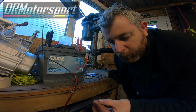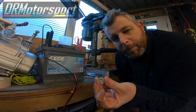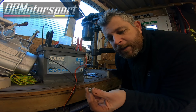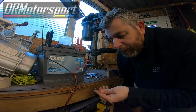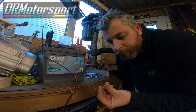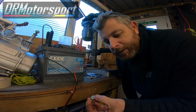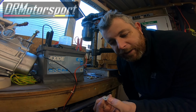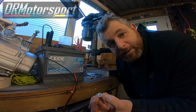to the actual sunroof. Basically, because I had to drill them all out, there are still remnants of the aluminium rivets inside them. So the first of a few jobs today is obviously to drill them all out. Obviously there's quite a few, as you can see. Drill them all out, put them all in with the rivets, make sure all the sunroof lines up, and hopefully by the end of the day I'll have the sunroof all fully fitted, externally and internally, with the head lining in, or at least that's the plan.